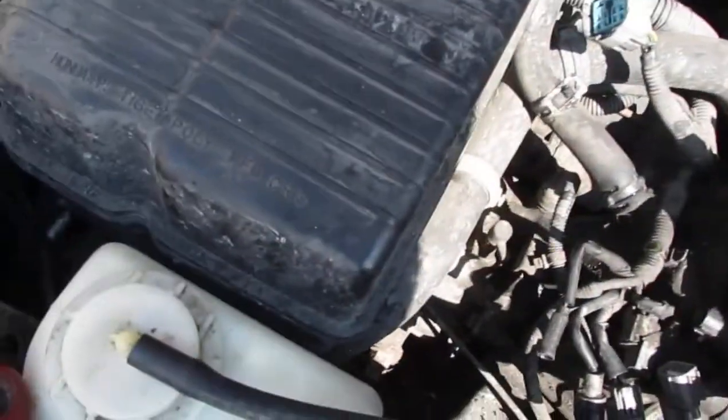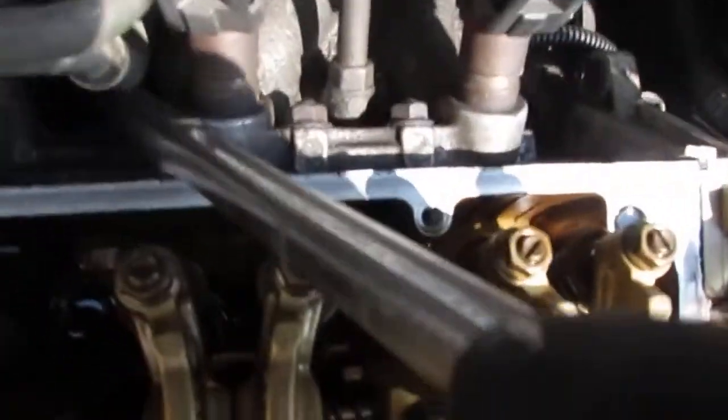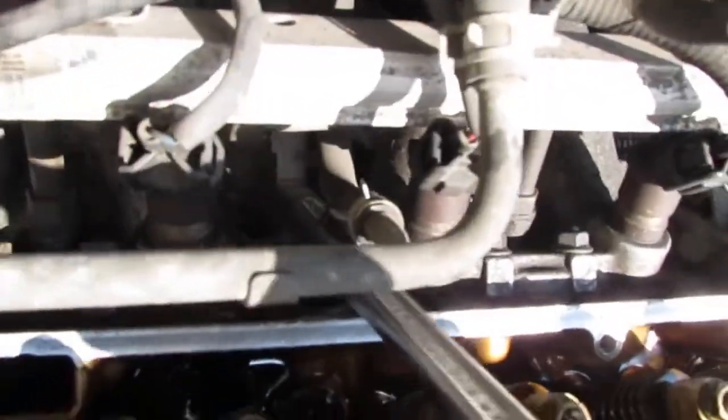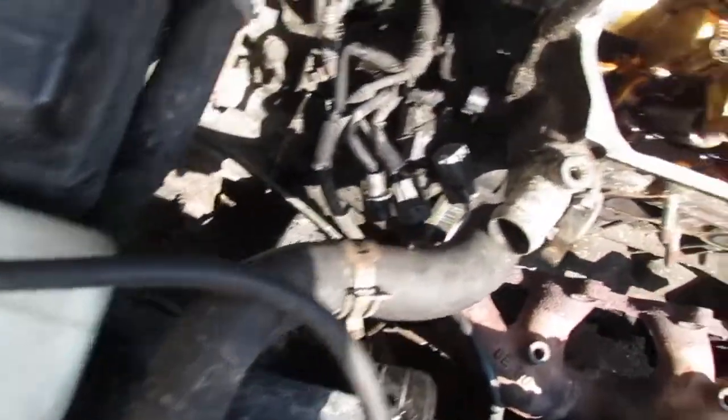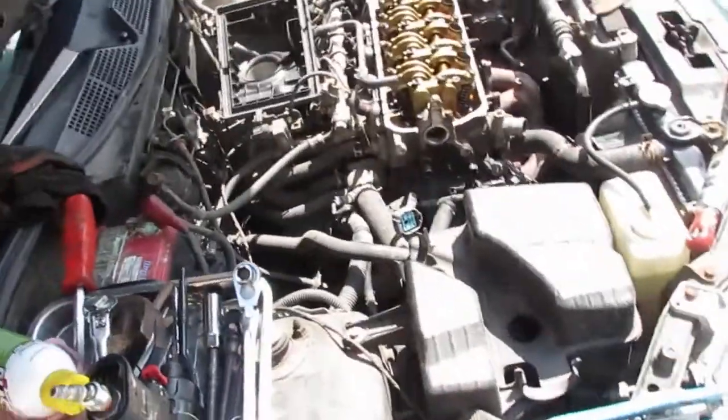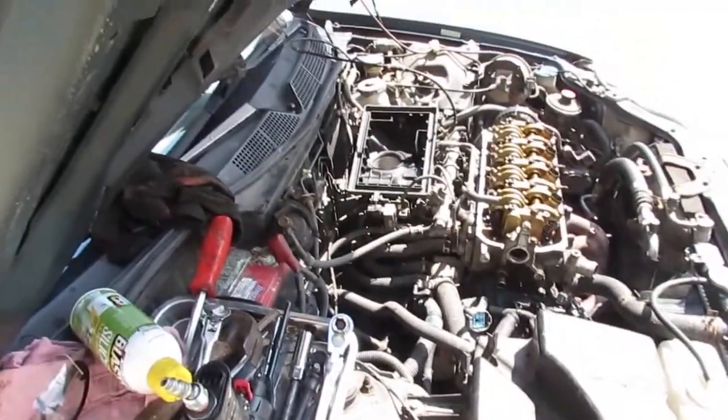We have some bolts holding this intake on. This is going to be the most annoying one to get at. It's not difficult, just annoying. Okay, so we have that there. It's also subjective experience, isn't it? What's difficult? So here we go. We have 1, 2, 3, 4 behind this, 5, 6, 7 to pull off. And those are all 12 millimeter bolts. Okay.